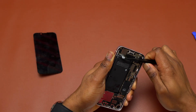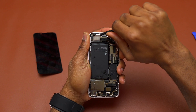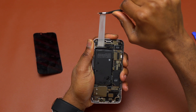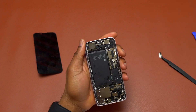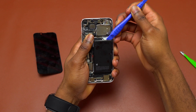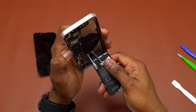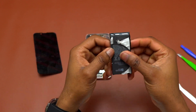If you want to keep the battery health stat, you'll need to desolder the small board on top of the battery and transfer it onto the new battery and solder it on. To do this, you'll need a spot welder and a special flex cable to reprogram the battery on the motherboard. Doing it this way is the easiest way to replace the battery and have 100% battery capacity shown, even if you don't see the battery capacity number in settings. Thanks for watching — subscribe, like, and share, and I'll see you in the next video.